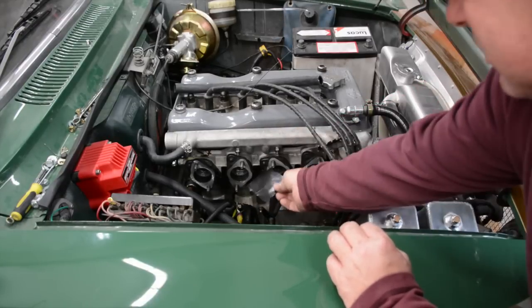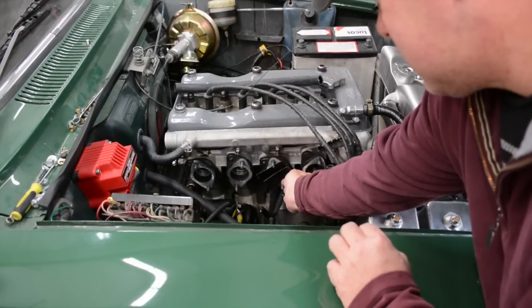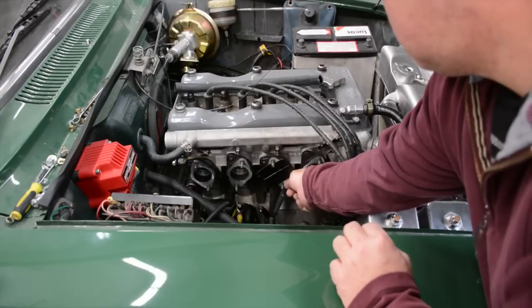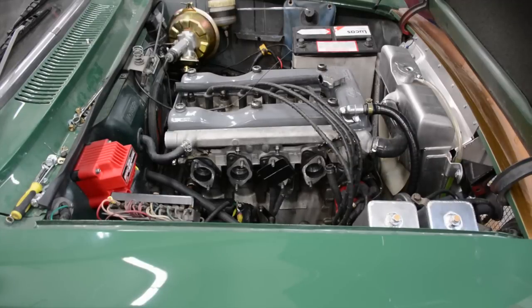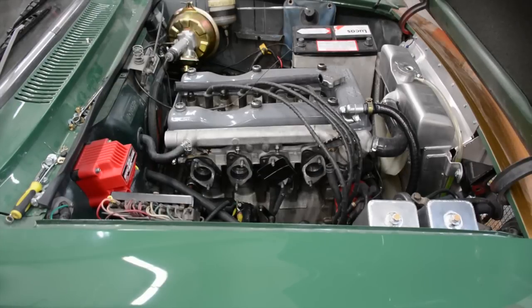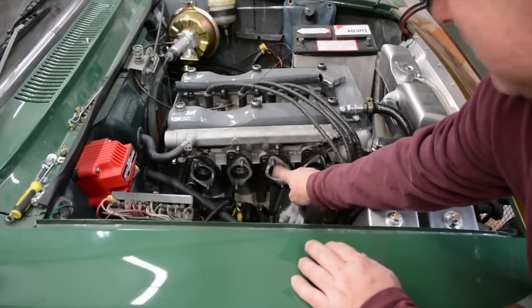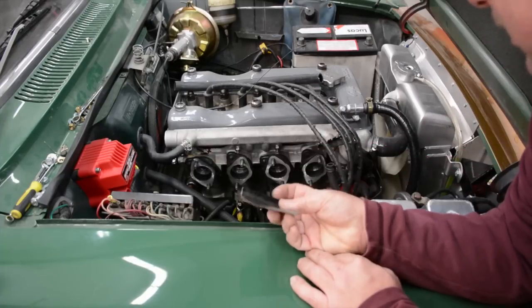However, when I move this to number two, just like last time, I must have missed something when we tore this apart last time. Now tape's over number two. And pay closer attention. You heard our squeak. So obviously I do have an air leak that is specific to the boot to here or from here to the actual intake on the head.